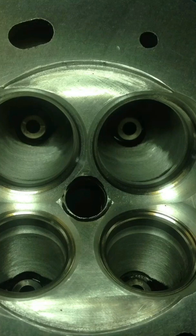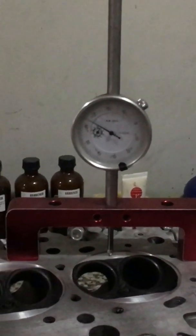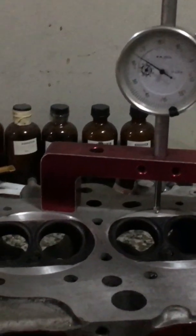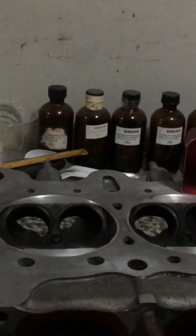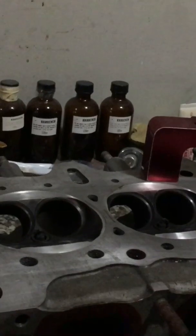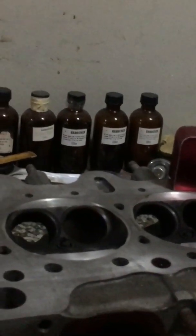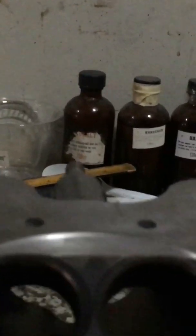Running 12-fives consistently. We have a link up here to check his races and projects, and also in the description below. Our machine shop of choice, Edmel, does this for us. It is called counterbore — they only charge 2,600 pesos for this, where they cut the bore and depth precisely. For our friends in the US, I think they call it fly cutting, or bore cut.